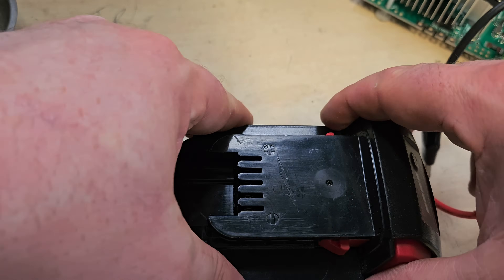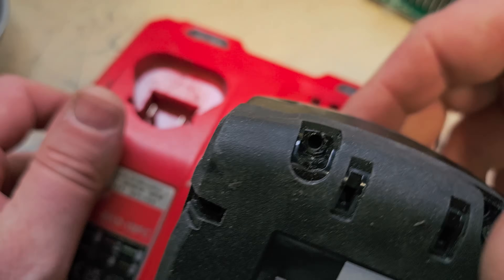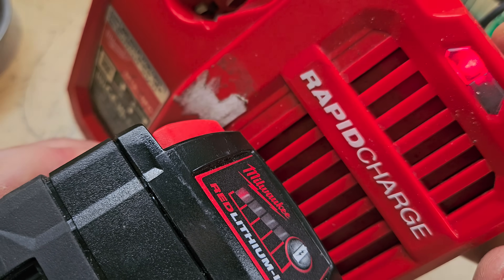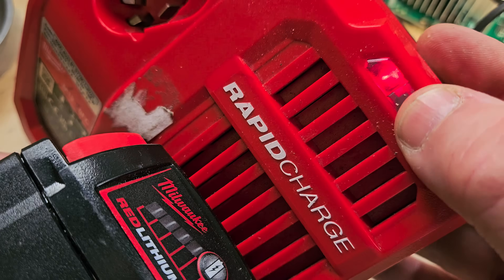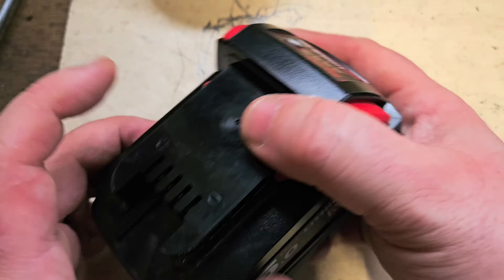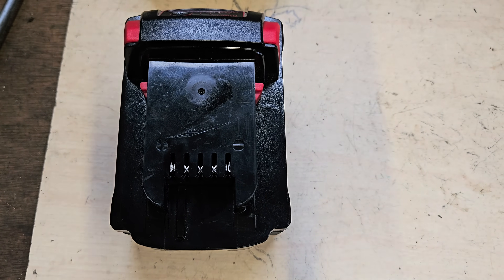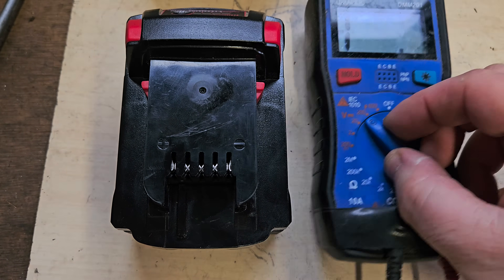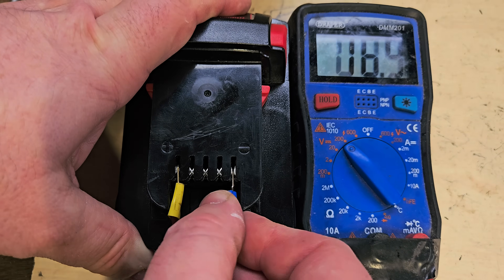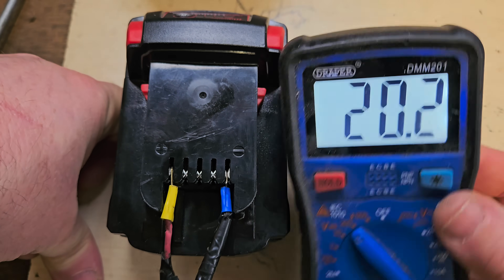When it charges up we can see how well it balances out, which it shouldn't balance out too well by the looks of things. We'll try it in the charger - it's charging, that's a good sign. It hasn't given me the Milwaukee Christmas lights yet. So we'll leave that for a while to charge up. With the battery off the charge, we'll just do a quick volt check on the top here, and this will tell us how we did - did the battery recover fully from the load test on the charger? And the answer is yes. That's a perfect battery - the voltage in that battery is perfect. That surprises me, but it's pretty good.